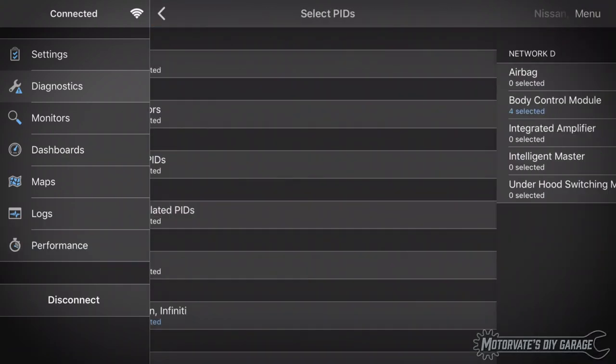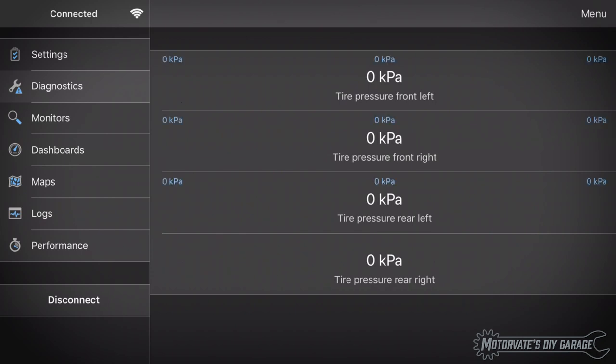Touch Back, Back, and Back. It looks like it's not working — all the tire pressures are showing zero. To maximize battery life, the tire pressure sensors enter a sleep mode when the car is not moving. They wake up when the vehicle speed is more than about 40 kilometers per hour or 25 miles per hour. So, time to go for a drive.